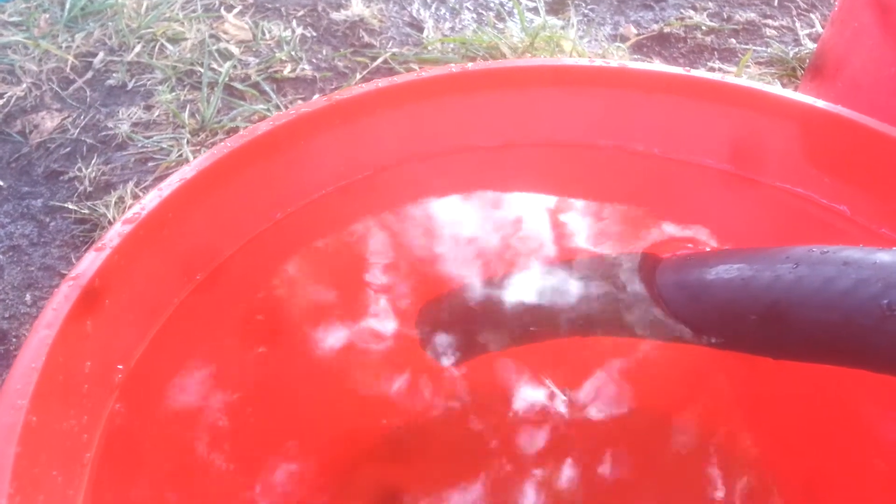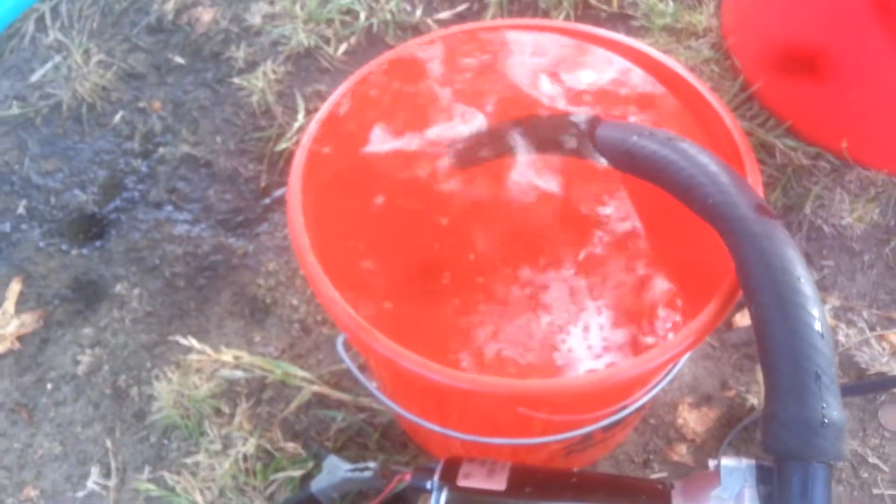Here's how you can test your Bosch pump. It's a really crude, rudimentary way to do it, but plug this thing in and watch the water level rise. So if you're ever wondering if your intercooler pump is working or not, this is a good way to test it and you'll be able to see.